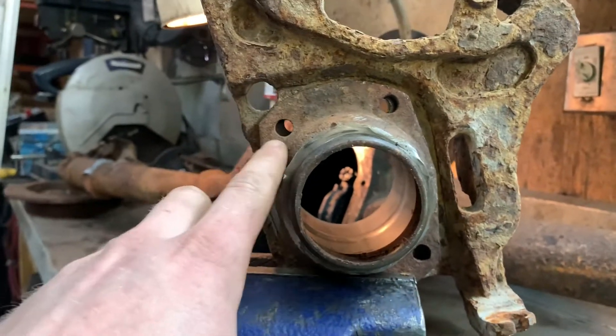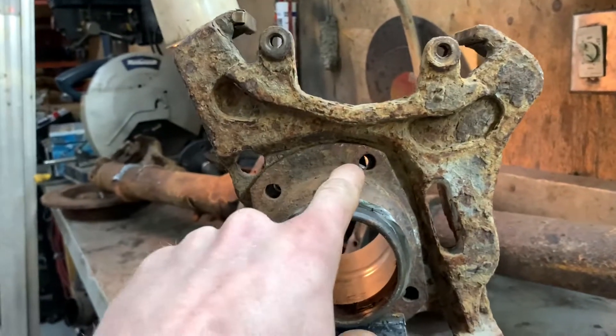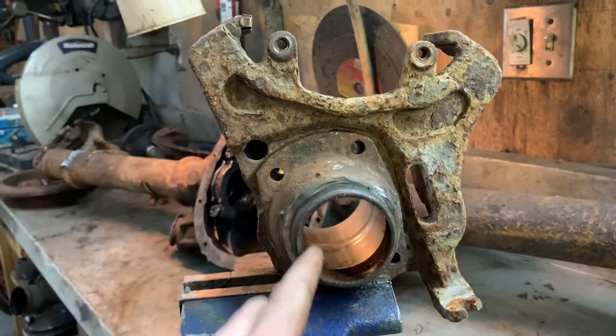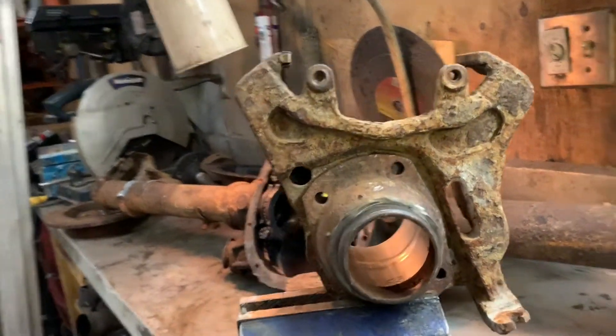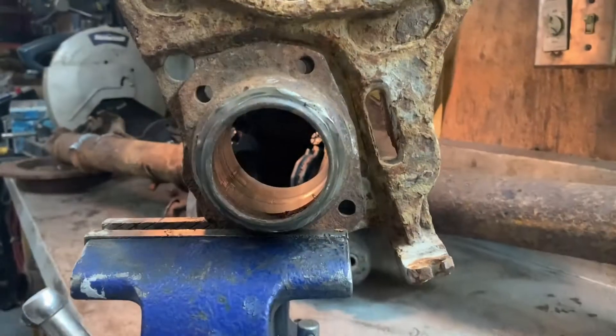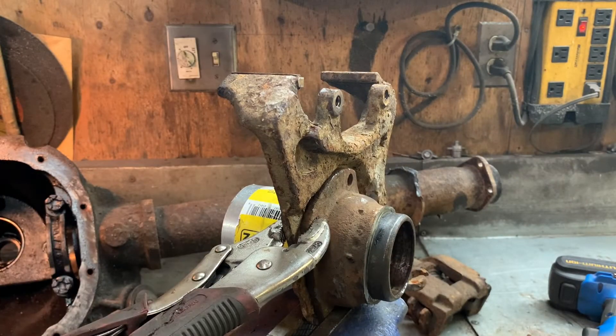After I get this aligned perfectly I'll nip it in the vise, put a pair of vise grips somewhere where I can, and drive a drill bit through there, bolt it, then drive a drill bit through the opposite corner, bolt it — and then I know that it won't turn on me as I'm drilling it out. This is going to be a whole lot easier than I expected. Close enough — let's center home with the drill bit. That's not going anywhere.